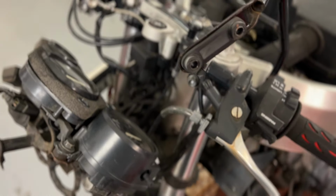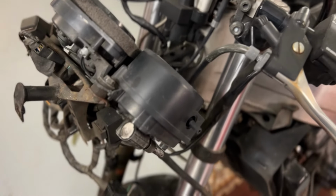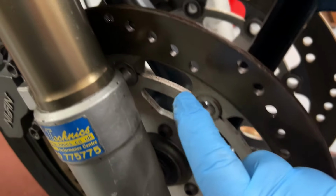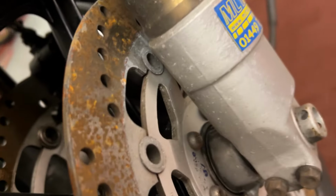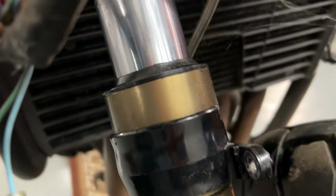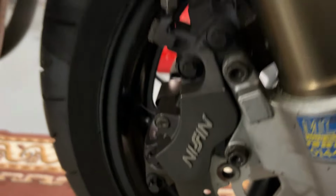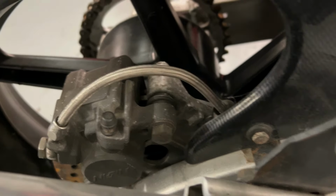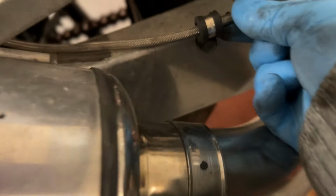It has a myriad of electrical problems. Luckily it's an old bike, so it won't take too long to trace them. This disc is sopping wet. The other disc is bone dry and corroded. It's going to be fork seals. And I'll need to rebuild the calipers. What a lucky boy I am. The rear gets it too. Lovely, look at that. Oof. So good.